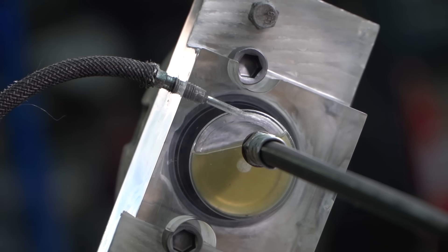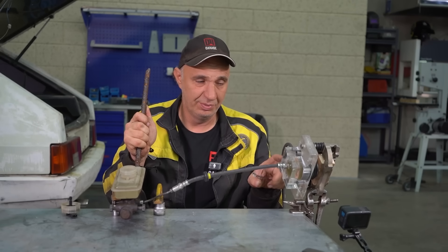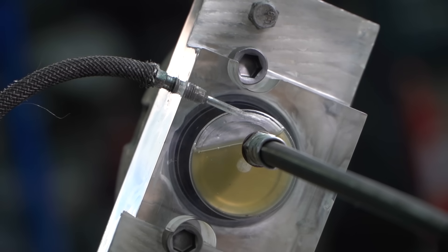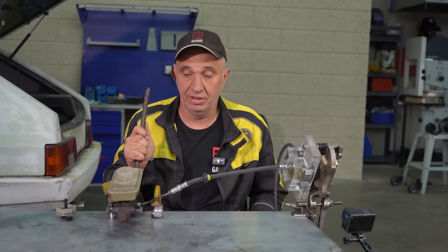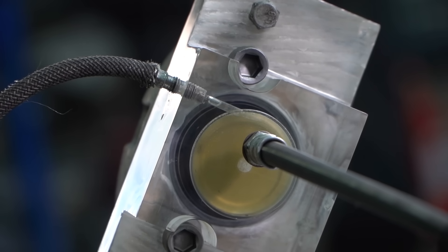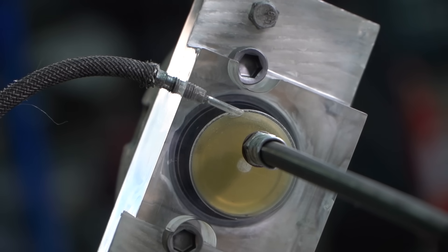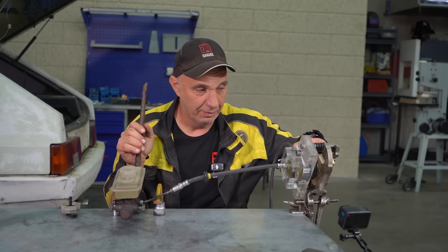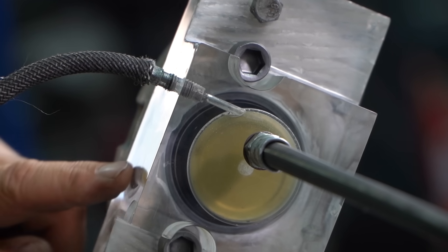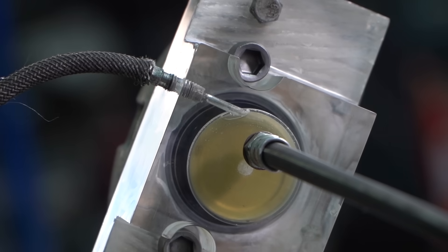Now, you'll remember that the typical brake bleeding process involves one person holding the brake pedal while somebody else releases the air. Because if you let go of the pedal while there's still air inside the system, this is what happens — you let go of the pedal and the air finds its way back into the hose. The takeaway here is that this is no way to bleed the brakes. I've also seen many times how people stab the brakes abruptly in order to bleed the system that way. But with the air moving around so actively, what actually happens is the brake fluid starts to foam. The big air bubble turns into a bunch of tiny ones that are really, really small. They disperse and find their way all around the fluid in the cylinder. But if you let it sit, all of the tiny bubbles rise and join together to form one big bubble once again — that's going to result in the brakes becoming mushy once more and in need of bleeding.